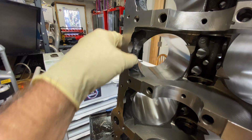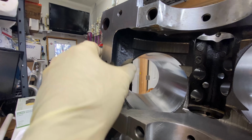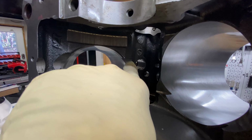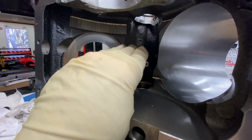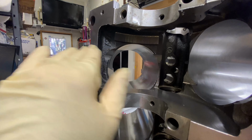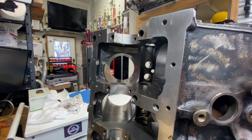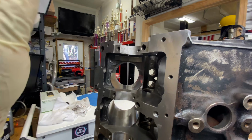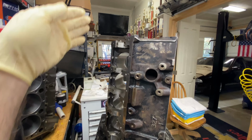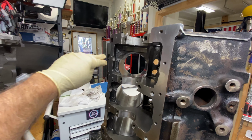Also make sure that there's what I think is, by eye, the right amount of rod clearancing. You have to do it here inboard for the rod shoulder and here at the rod bolt area. And hopefully this is going to work. This is a 3.75 inch stroke. It's a 383, so the rotating assembly as the next step will get mocked up and put in there, and hopefully the rods will not bump.